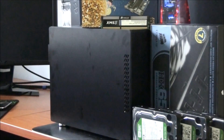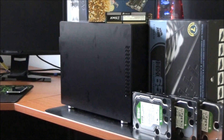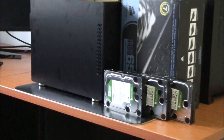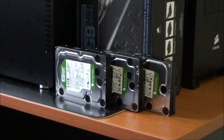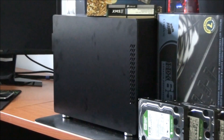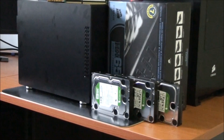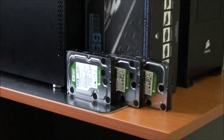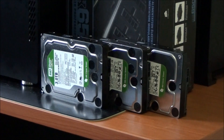The case that I'm using is the Lian Li PC-Q25. I also have a review of this on my channel, so click on the link to check that out. I'll give you a much better look at the case as I'm building the computer. The hard drives — I'll be chopping and changing hard drives a lot because this case actually has five hot swap bays for 3.5 inch drives. It's a perfect little case for a NAS build, and this is only the hard drives that I'll be using initially.